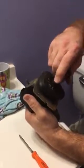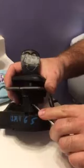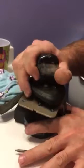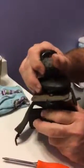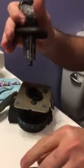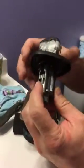Again, put it on the first position — you have off, accessory, then the first position. You're gonna push in this little detent, pull up a little bit, take the tool out, and then push in again. There we go — it's a little tricky, but this is the lock that keeps it inside of this housing.